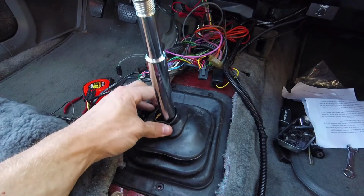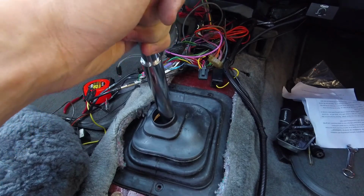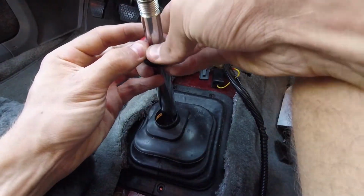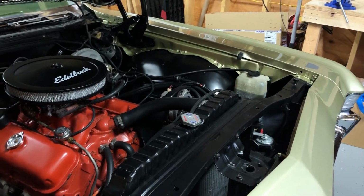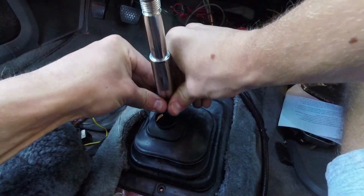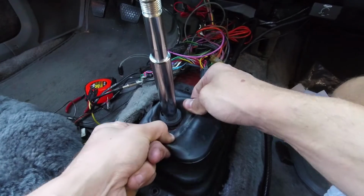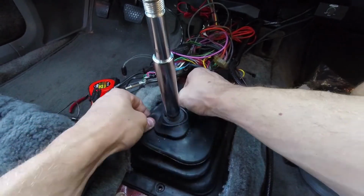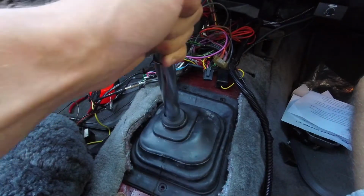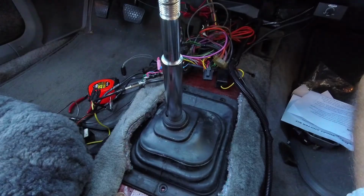With the rubber boot back in place, we can clearly see the issue with the smaller diameter shift handle. I did some digging through the garage, and managed to find an old valve cover bushing from the 396 in my dad's 1968 Impala, that seemed to match the inner and outer diameters I was looking for. I slid the bushing down the shifter and snugged the boot into place over top of it. I later added some tape to help keep the boot from falling off, and while it's far from perfect, it at least makes me feel better about the whole thing.